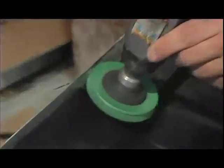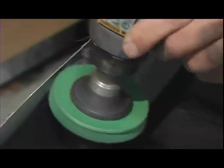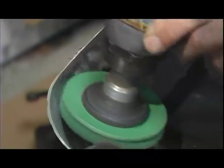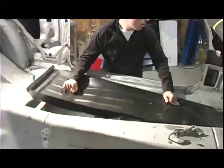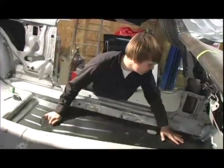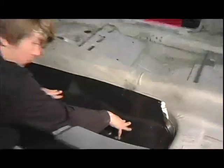To make it easier to cut, he removed the panel and brought it to the bench, where the guys taped off the whole area with bright green 3M masking tape that's easier to see. Then Nick and Tom proceeded to cut the panel to size using a cutoff wheel. After the main cut, Nick used an abrasive wheel from 3M — we call these little green finger wheels. They're nice for removing the factory E-coat off the panel so it can weld cleanly, and they take off burrs without grinding the panel too thin on the edges. Being a butt weld, we needed maximum material thickness on the edge so the welder didn't just burn it away.